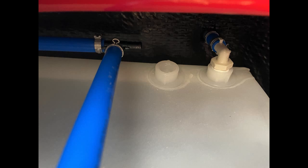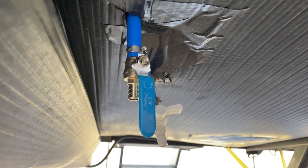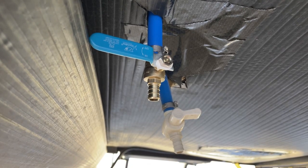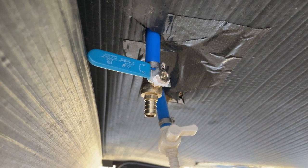Specifically, I built the 90-degree fitting outside and then installed the T on the inside on the other line to conjoin them, running a new line straight down as well. I added a ball valve onto the drain line for the overflow, and from there added another length of tube that runs all the way into our pass-through right where the water pump is. The reason for the ball valve: once the tank is full and starts overflowing, you can shut it off for transport. You actually don't even have to open it again at the campsite, because the fix includes an air inlet that continuously lets air into the tank to prevent collapse when using the fresh water pump.